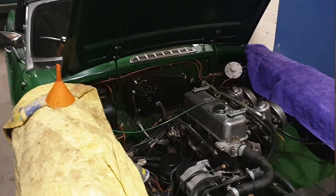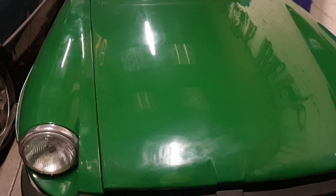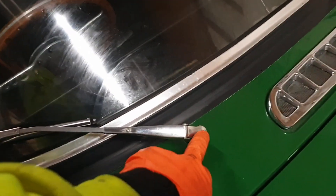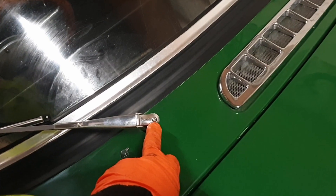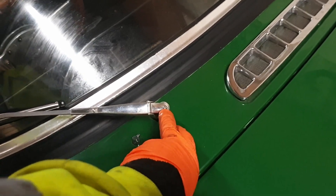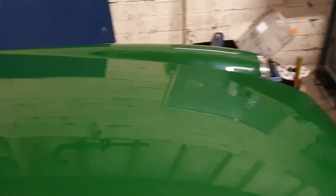So we've got to do something with the wiper boxes. I don't want to change the wiper boxes because they're in good nick - going to try a bit of a cunning plan to see if it works. The problem was the splines were knackered on this wheel box and sometimes it would pop off and then wouldn't turn, so you'd have to knock it back down. What I did was drill it with a 3.5mm drill bit, then tap it M4 and just use an M4 by 12 button head bolt, which keeps it nice and secure.